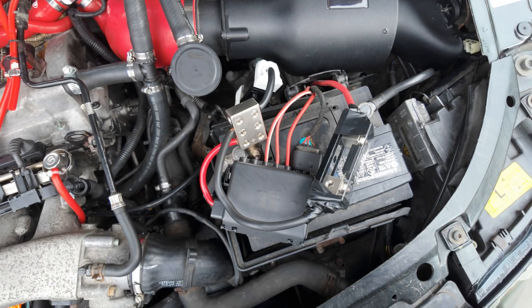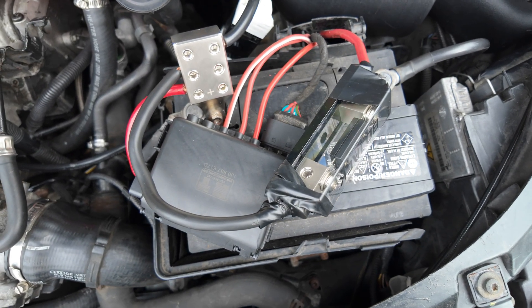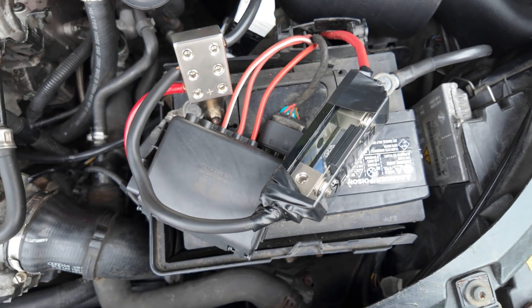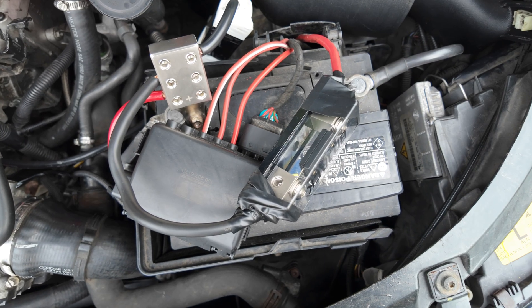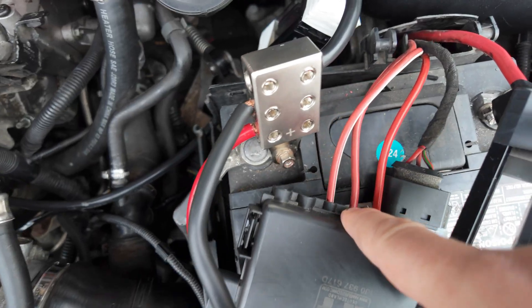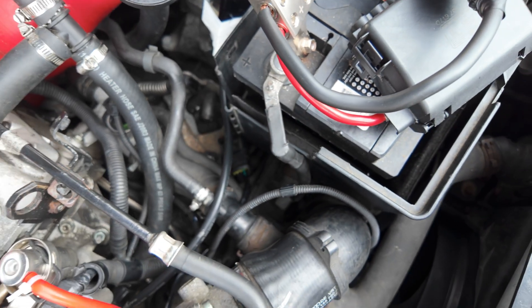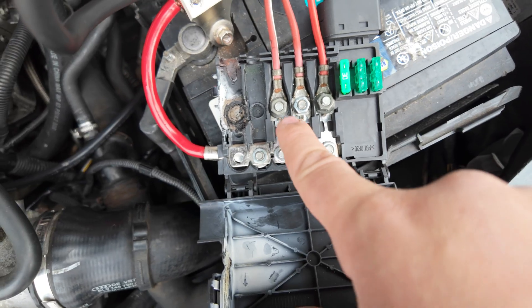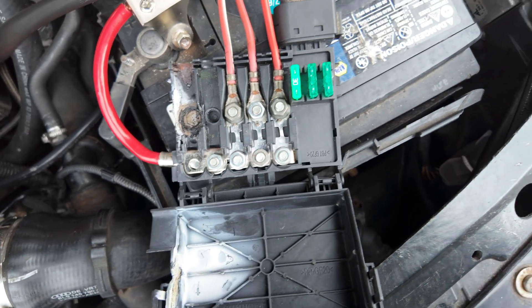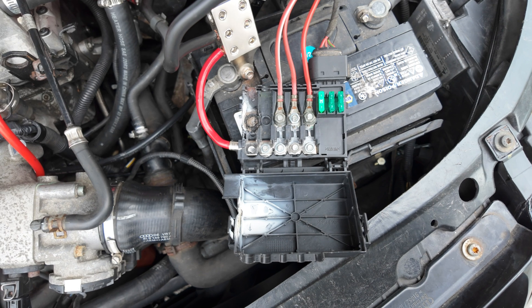We've still been having some electrical issues. Nothing's been getting hot, melting down, or overheating — we've just been experiencing visible electrical issues in the car. The first thing you may notice is this post is now in a different location. What I found is this post got stripped out and it wasn't very tight — multiple connections in here are stripped and will not tighten down all the way. So clearly we're just having some connection issues. I do have a fresh fuse box on the way.